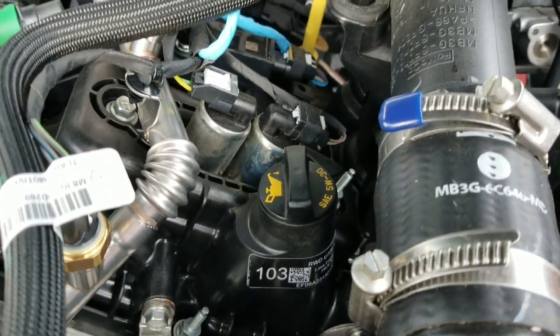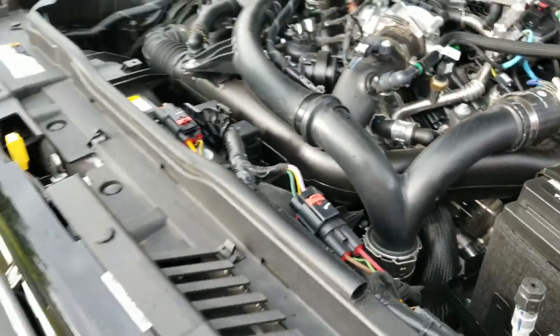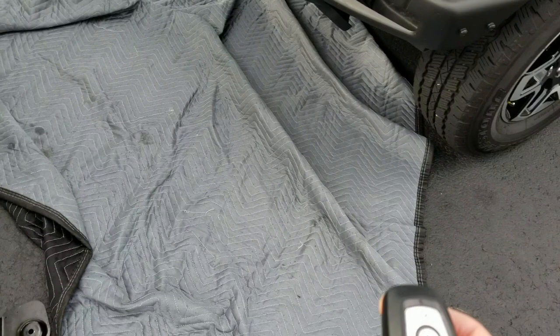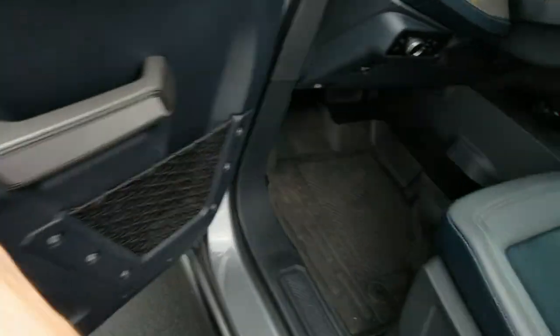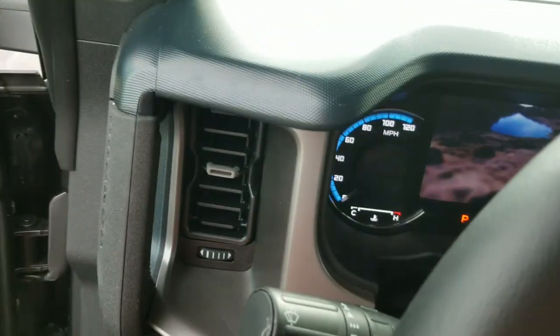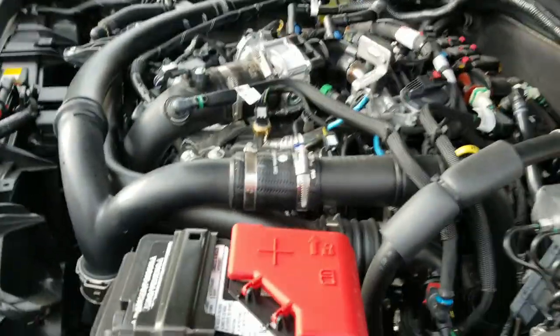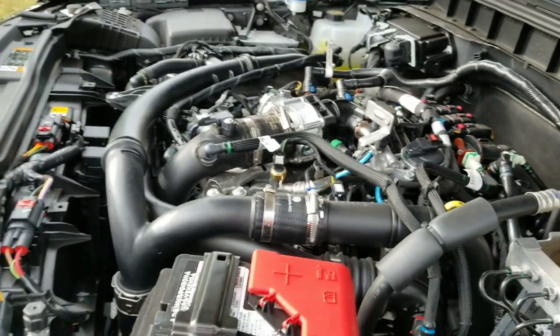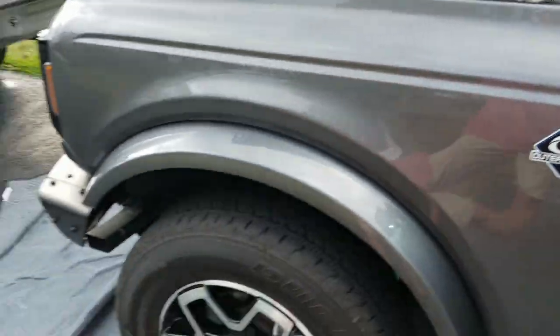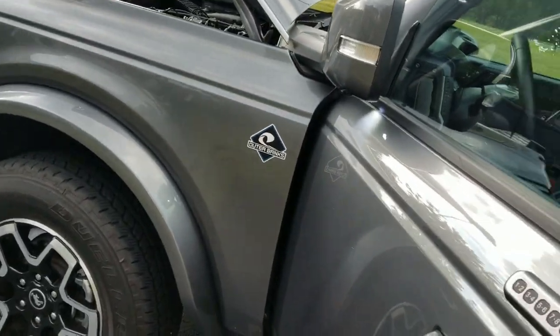Five quarts in. Putting the oil fill cap back on — if you don't, the valves might splatter oil out. Let's start the engine. It won't start with the hood up remotely, but I got it. I'll let it run for about a minute just to fill the filter. That cartridge filter takes so little oil — it's not like the big old filters back in the day. The question is whether this engine takes five or six quarts.